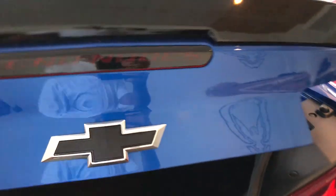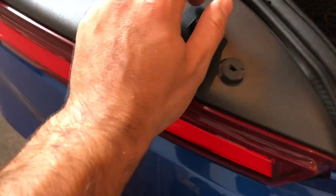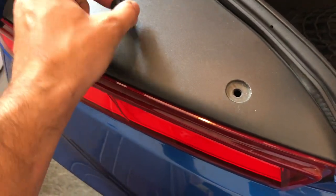I'm going to get these installed and show you guys a quick rundown on how to get them installed — it's pretty easy, literally nothing at all. Just these three little T-clips over here on each side. Pretty easy to take out. All you need is a flat-head screwdriver — pop up the head and just pop it out. Look inside your trunk on each side and you'll see these little pins. There'll be one right here and one on top.